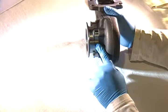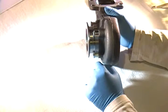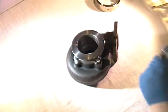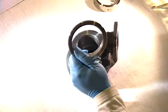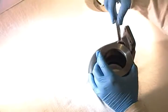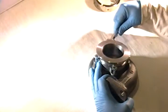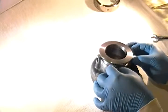This adds about an inch to an inch and a half of room, so it may push your downpipe further toward some obstruction that gets in the way of the way the downpipe bends. The other issue noticed for some people is that you actually have to weld this flange onto your downpipe — there's no bolt-on flange system for the downpipe side. You're going to have to take the four-bolt off, weld the flange on, and possibly even relocate the downpipe by a couple of inches to make room for this.